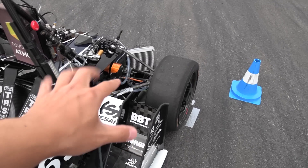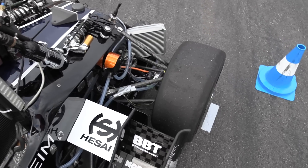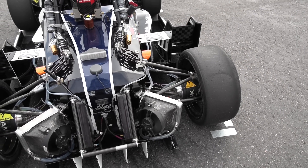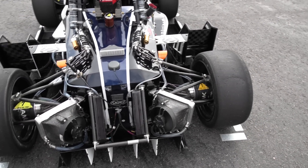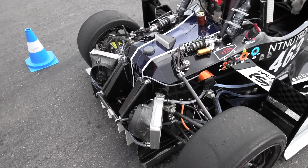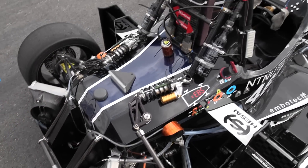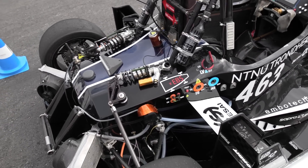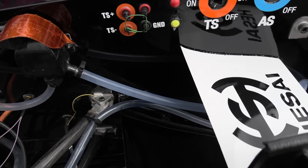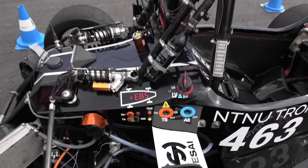So the quad motor — how much power is in each motor? The motors can do 21 newton meters torque and there are four of them. On the wheels we have about a 15 gear ratio, so it's about a thousand newton meters torque in total, which is quite a lot. You can see the water is flowing — so we have water-cooled motors and inverter. The inverter is also water-cooled, and the processing unit of the driverless computer is also water-cooled.